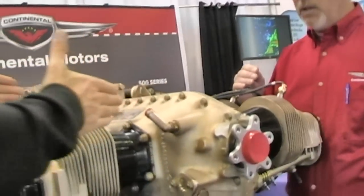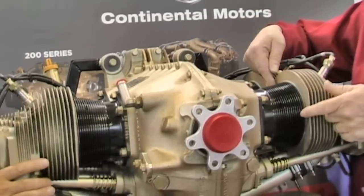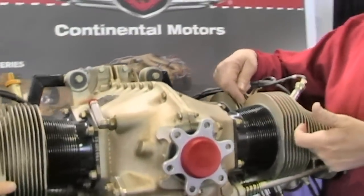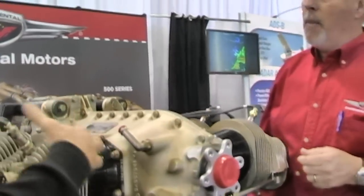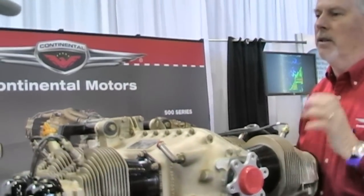So the tapering runs this way on that cylinder — absolutely. At the base, the center of these fins are much shorter. They're much taller up near the top of the combustion area, and that's definitely where the main heat is. That's absolutely where we generate most of the heat and most of the power in the power stroke.